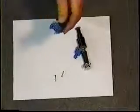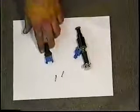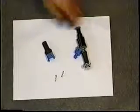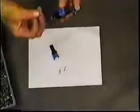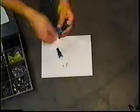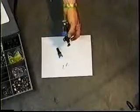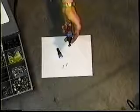These injector connectors and clips run about $10 for the two ends, so at the price of an injector harness, this is a very easy way to repair your harness without having to disassemble the whole wiring harness and replace it entirely. As far as cleaning these injector connectors, the best way is a dry method. I have a small sandblaster with extremely fine glass beads and a special boot that protects it as I spray over the top — it cleans the connector off. I can do it in-chassis, and we run a vacuum cleaner constantly to keep all the dust and dirt down, as it is quite abrasive.